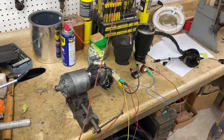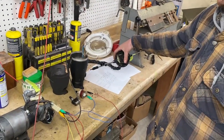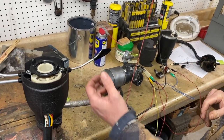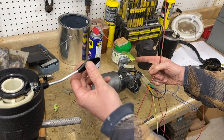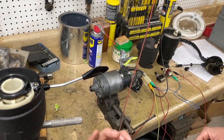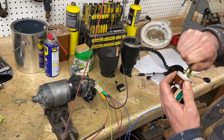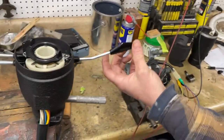We're all wired up. We had to change some of the wiring because this switch was wired for two-speed, but now we had to switch it back to variable-speed, so we changed some of the wiring in the plug. That's on — so that's off or park. Let's watch: it will always park in that position no matter when I turn it off. It's going to go back and park. There's on, and now I can use the rheostat to increase the speed. And there's variable-speed fast. Then I can turn it off and park.